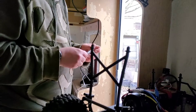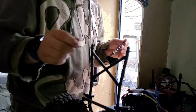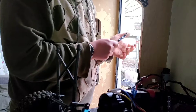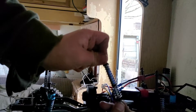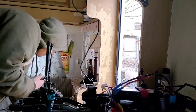You just want to work it in there — make sure you push down and up. So here we are. This is the standard shock — when you push it down that is instant rebound. Then you do it with these — push it in and it's slow. I think I'm gonna have to drain a little bit of oil out of this; it's just a little bit too much.